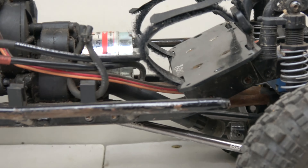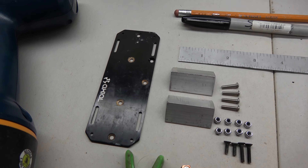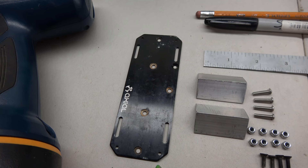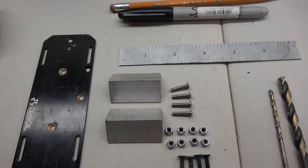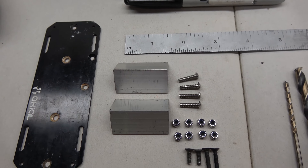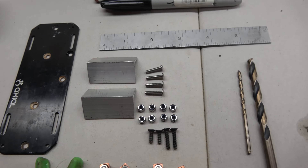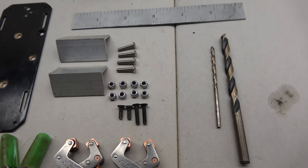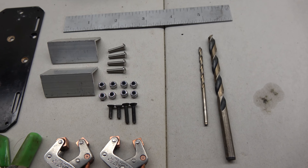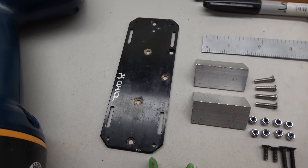So let's see how to make it. This is about all you're going to need for this project. You need the stock SCX10 battery plate along with the two straps that it comes with. You need two pieces of three-quarter inch angle aluminum cut at one and nine-sixteenths inches — you can buy this material at pretty much any hardware store for around five bucks. You're going to need four cap-head three-millimeter screws, eight three-millimeter lock nuts, and four tapered-head three-millimeter screws. These will be going in the top of the plate, and you need to countersink them so they don't interfere with your battery.